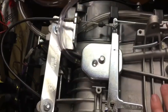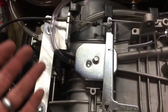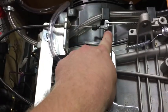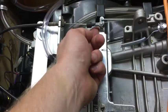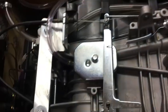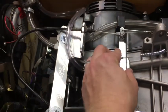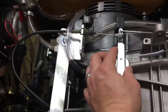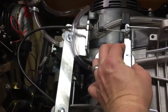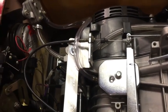The throttle linkage is a little interesting. I'm not super happy with the way I did it - there's a drop in the cable. I used the piece they sent, bored out a hole, and put the pinch clip underneath. It's working, but it's very sensitive - if there's a little bit of flex in the cable it makes a huge difference in your RPMs. That's just going to take some fine tweaking.